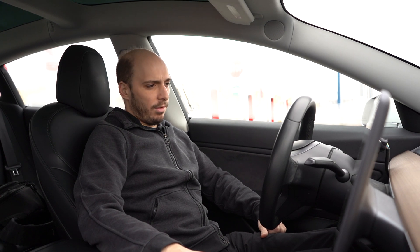So we're at the supercharger now. We've been preheating the battery on the drive down here — it's zero degrees Celsius (32°F), so it's a little bit challenging, but we have the battery at 35°C. We're going to start supercharging and the battery temperature will go up to about 40°C. Normally you'd finish supercharging with hot oil, hot stator drive units, and a hot battery — and only after finishing would you be able to cool on the way back to the track. Our cooling party box module can bring that down using the supercharger's energy, so you can leave with a full battery, drive efficiently to the track, and arrive with a fully cooled car.